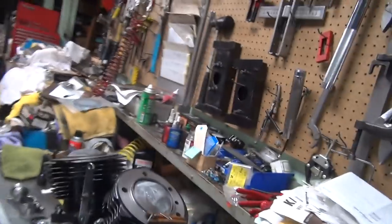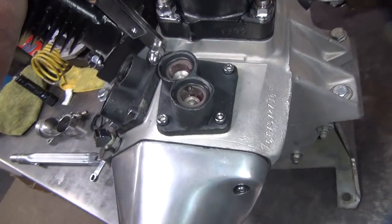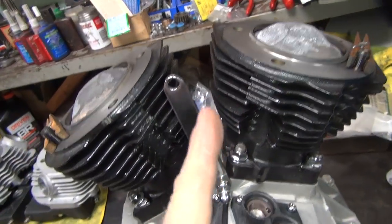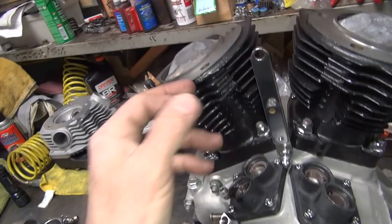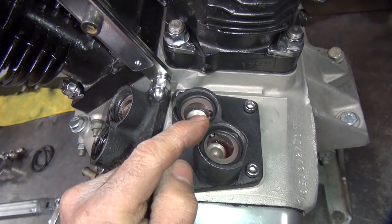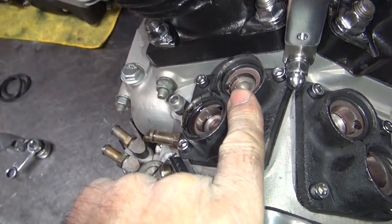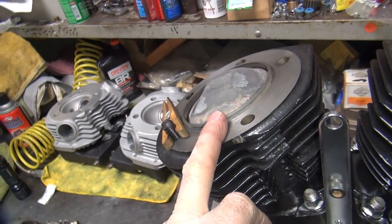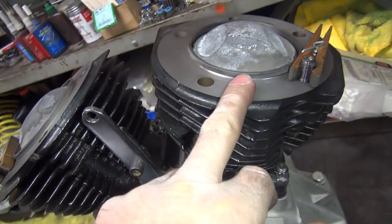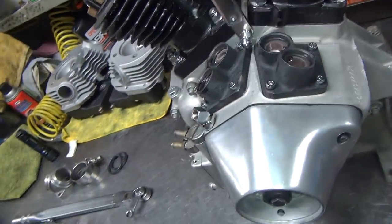Some people get confused on how to do a valve adjustment with push rods. Right now we're gonna make it simple. We're at top dead center, almost, for both cylinders — but only one of them is on the compression stroke, the other one's on the overlap stroke. The way you tell which is which: look at the lifters. If the lifters are down and not moving, you're on the compression stroke. If the lifters are up and the piston's up, you're on the overlap stroke — both valves are open, no firing going on. The power is on this one next time around.